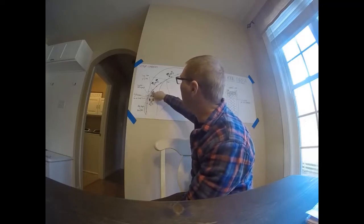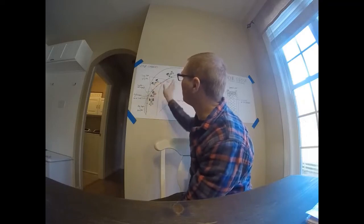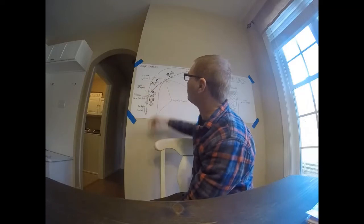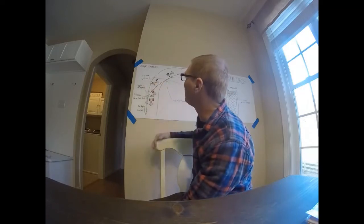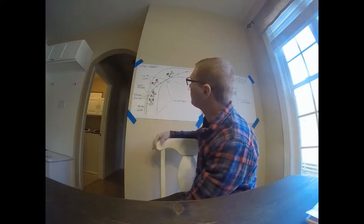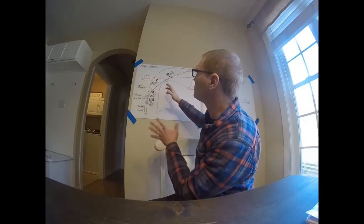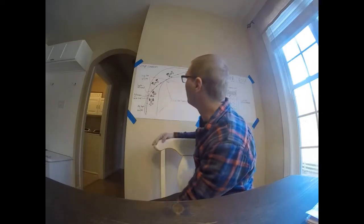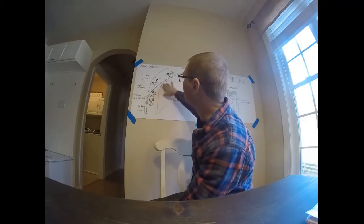Once we've trailed all the way off the brakes here, we're going to be primarily in lateral force. So in this example, a right-hand turn, we'd be putting the load on our left-hand tires. That's what we really need to think about. Again, sway bars and spring rates. What's the balance of your front and rear here? And how well is that keeping the car pointed toward the apex?